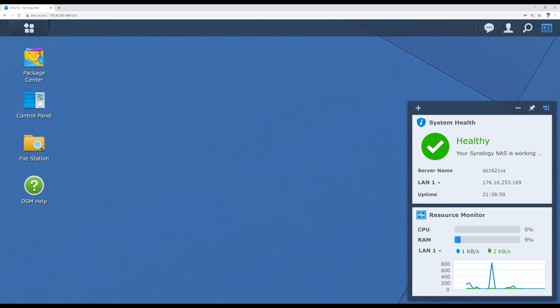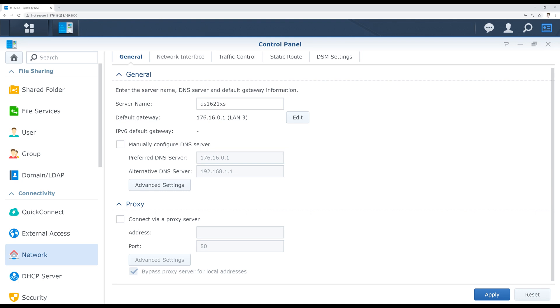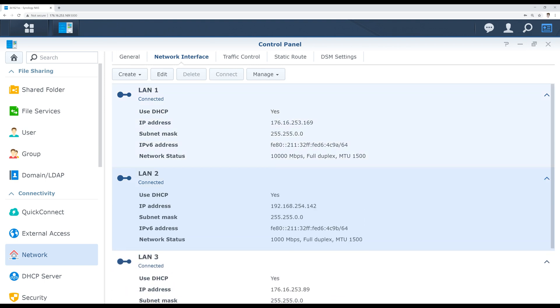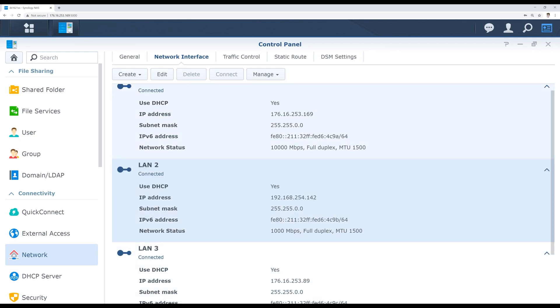Let's dive into DSM and look at both the caching and networking side. The most important thing with this version of NAS: on most other platforms you had to add an external card to get 10 gig. Here, LAN 1 is a 10 gig connection. One odd aspect we found is you can't use the 10 gig interface as your primary interface during initial deployment — only 1 gig is active during the initial setup stage. So you almost have to access it like a management network over 1 gig first before it enables the 10 gig port.